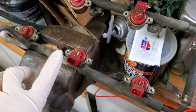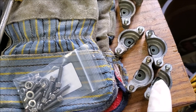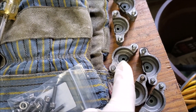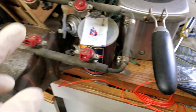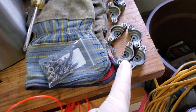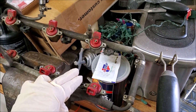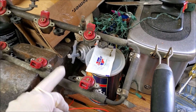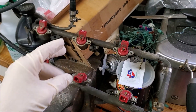Now once you get these caps off your injectors, I just wanted to give you a little insight: there is a rubber and metal insulator on each of them that sits right in this little valley. On only one of them it popped out, but in previous work on a fuel rail I've had multiple fall out — you just don't want to lose those. However, for this early style to new style injector install on an early style fuel rail, we don't need these caps because they won't fit around the heads of the new style injectors — we'll be using a different set of caps.